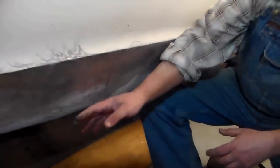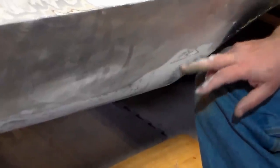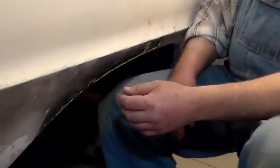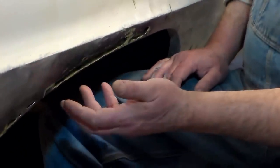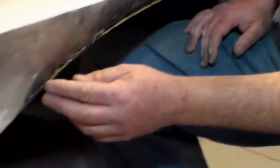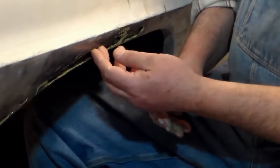Here's a spot similar to the other side. I tapped with the hammer, knocked out all the rust, came in with the grinder, cut a bunch of metal out, then I laid some short-strand fiberglass in here. I put the metal back in — it looks like crap right now but I'm getting ready to pull this with some Bondo and it'll come up looking nice. I wanted to show you this ugly part above the rim of the fender well. I didn't get too carried away cutting out here because I need the structural integrity — I need a surface to build from. So I did the absolute minimum: drilling and grinding until I got rid of all the heavy rust.